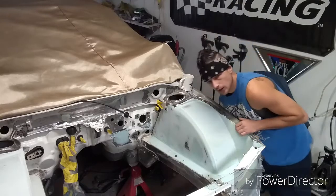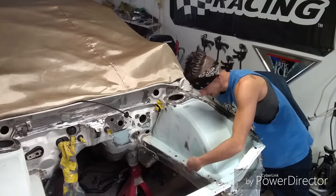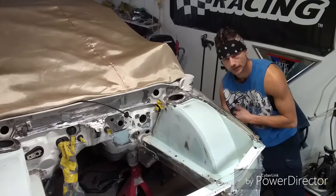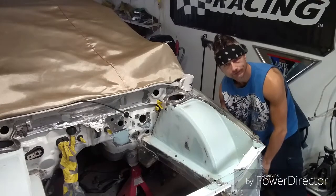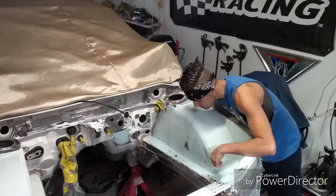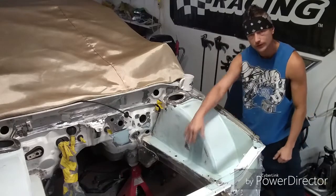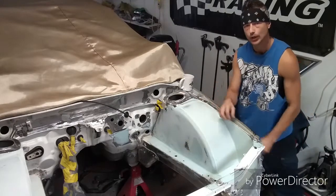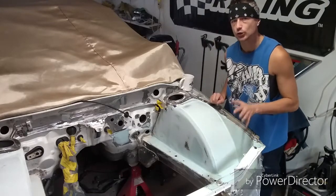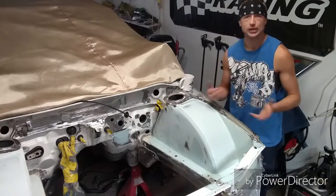So you're going to hold this panel out on the inside right here because it's in. We're going to have to get on the inside of this wheel tub. Guess what's coming out? The BFH. Big hammer. Yeah, so that's coming out. We're going to manipulate this back on this corner on the inside so that I can let go of the pressure of this panel and it stays there with memory. Steel always wants to return back to its original state, guys. Help it do so.